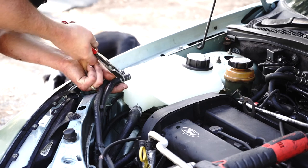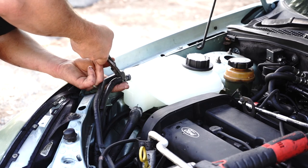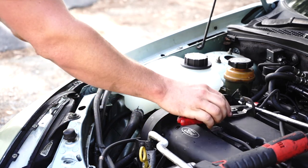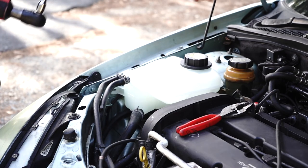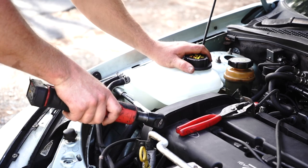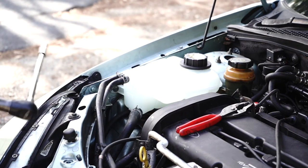This one's a little bit more difficult. There we go — the two hose clamps are nice and flush. Next step is to put our 10mm bolt back in where it came out of, without dropping it. Done. And that's your overflow bottle reinstalled into the car.